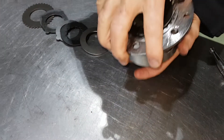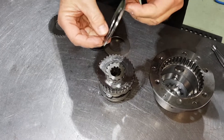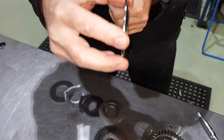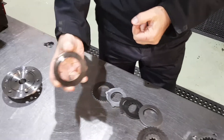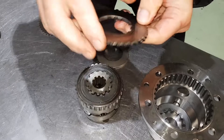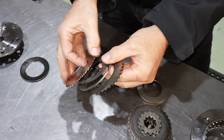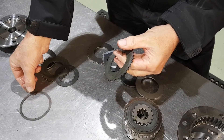Now the complete assembly will come out. You'll see the Belleville washer — it's like a flat washer but it's got a dome in it, and that's what gives you the preload. It's basically a spring, very much like a clutch diaphragm spring — does the same job, just smaller. These are the friction plates that wear out. You've got one, two — and you don't have that part on a Mini; that's the extra part, it's a slightly different design.